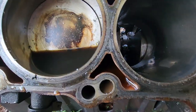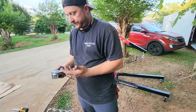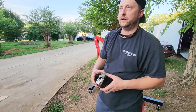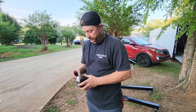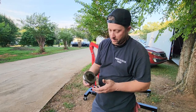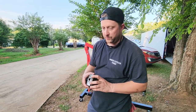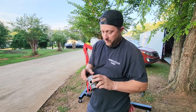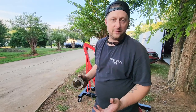I think it was the springs. We were probably making — you know, this motor is probably making 800-900 horsepower to the tires, per our weight and mile-per-hour on the track. We guesstimate probably 800 wheel. I mean, we were beating and hanging with Red Eye Challengers, so we were making some steam. But it looks like the motor failed because I think I'm going to go with the springs — those springs didn't want to keep up with the task. Maybe too high of RPM. We were shifting that pass — we crossed the traps at 7300 RPM.